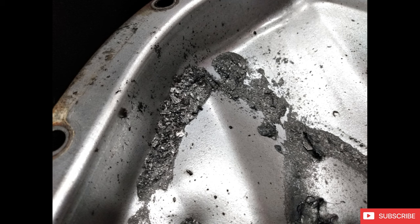It's actually a press fit in the brackets between the frame rails, and it's very difficult to get out. Mine was not only press fit, but also kind of seized from just years of corrosion. So I had to beat it out with a hammer and a very long pry bar. I reused mine by cutting and welding it significantly.